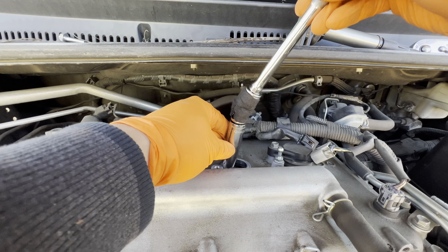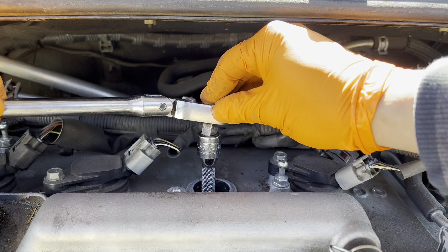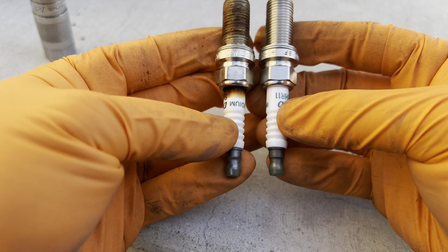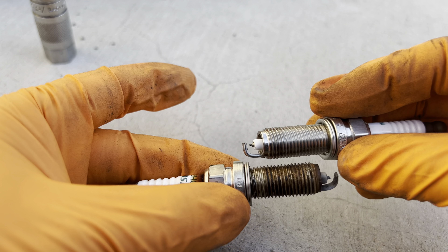So you can get a very small flat head and as you push down — this is not a lot of force — you just kind of help it get up and pull it off. Be very careful if you do this because if you put too much pressure when you pry this up, you can break the tab. Just very light pressure, go slowly, and try to pry it up and pull it out.